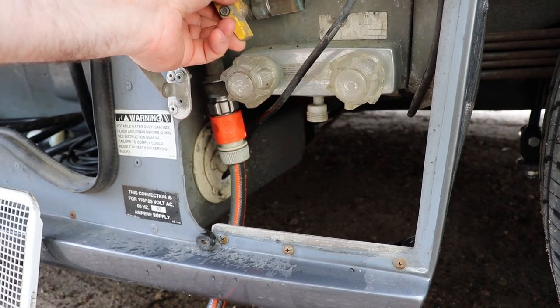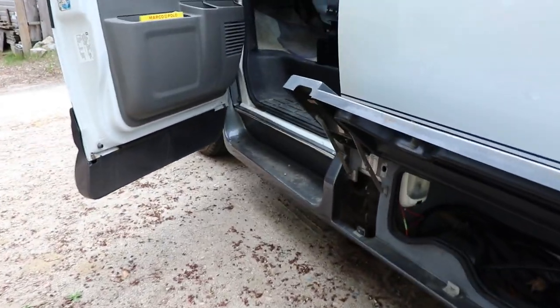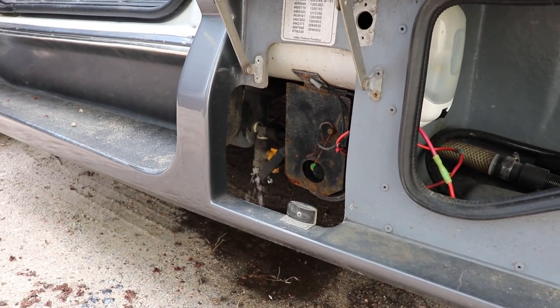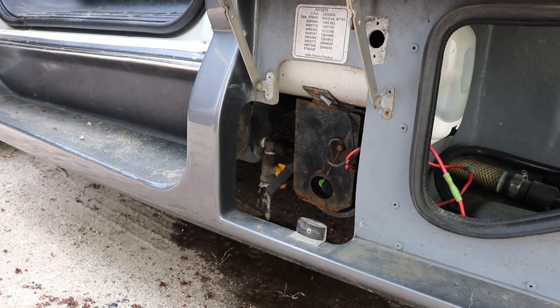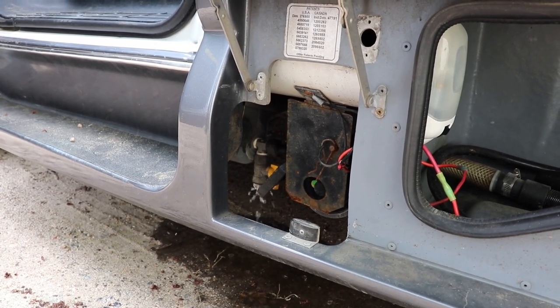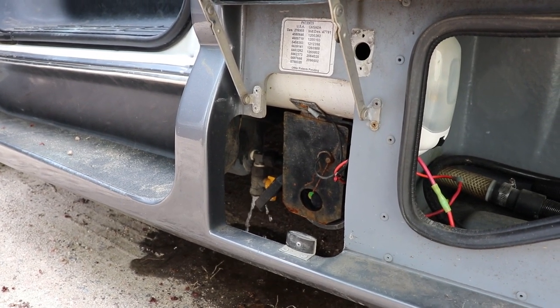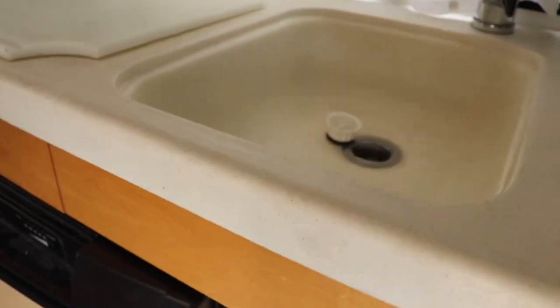This valve here needs to be closed most of the time — this is your fill valve. Even though it's yellow, don't be fooled, it's not natural gas; you can see it's hooked up to the water line. Let's turn it on slow. Water is pouring out of the front tank now. I'm just going to leave that drain open because there's a bunch of winterizing fluid inside. You're not going to flood your vehicle doing this. You obviously need to make sure your faucets are all off inside. We'll just leave this run for quite a while to pump out that sanitizing fluid, then we'll go inside and run the other devices.